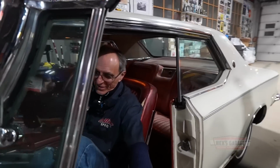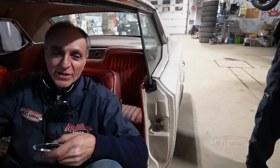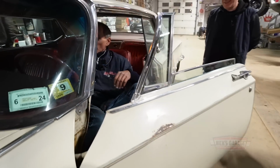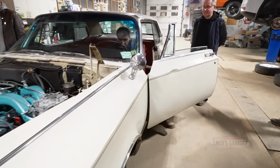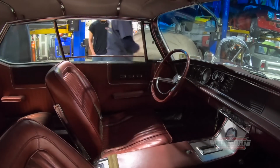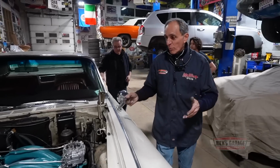You know, this is okay. So we're gonna fix the mechanical distributor. Yep. Like we did with the other one. Not a problem. We tricked the vacuum advance, get the tach to work, and of course we're gonna make it accelerate. Anyways, now we need an open road. It is kind of dangerous in the shop. I've got not enough clearance, but we know we have acceleration. Absolutely. And there we have it. So finally, now we can sleep. Now I'd like to make a little video on the road to show our viewers what we've accomplished here.